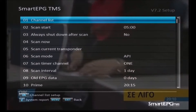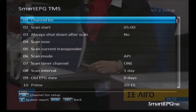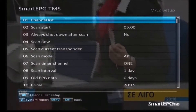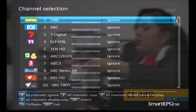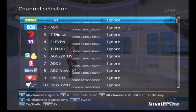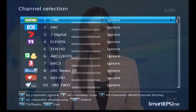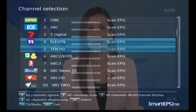There's a lot of things to set here but luckily the defaults are pretty close, so I'll just highlight the ones that need to be changed. We're going to start by making sure it's going to see the full channel list. We're highlighted on menu item 1, so press OK and it'll bring up the list of all the channels available. You'll see all the channels are set to ignore, and we want to change that so all channels are considered when the EPG does a scan. At the bottom of the screen you can see a zero button for all channels ignore, one for all channels scan. Press the one button and that'll change all channels to be scanned. You can see they've all changed now — just have a look down the list and they're all highlighted.